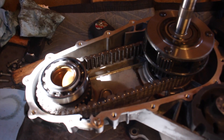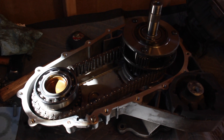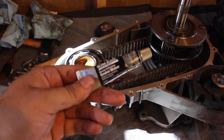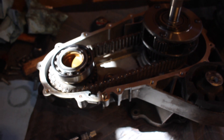So now we've cleaned all the surfaces — they look really good and clean. I ran over everything with some brake cleaner. The gasketing surfaces look pretty good; the rest is still pretty dirty but I'll probably clean it up after it's all sealed up. We're going to be using some Ultra Black Gasket Maker from Permatex. We're going to put a little thin bead all around, then finger-tighten the bolts and let it set for about an hour.